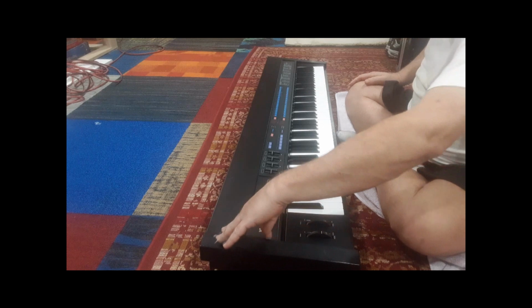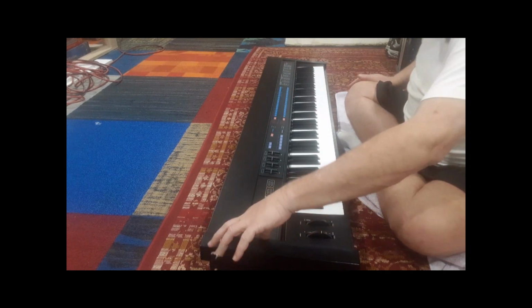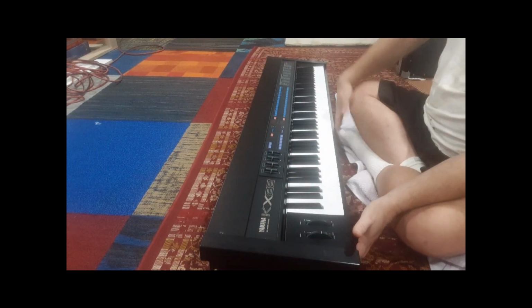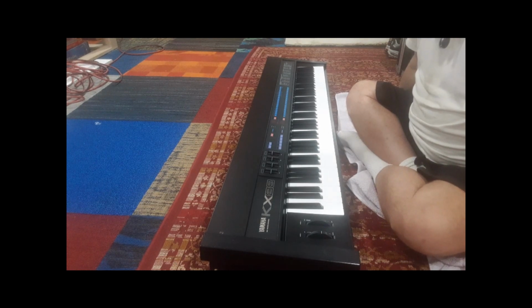And you put the 4 back screws in. Well, actually, you want to put the 4 back screws in, and then you want to flip it up, because you don't want this to flip down while you flip it up. So put the 4 screws in, flip it up, and put all the other screws back in on the bottom. I'm not going to show you that because I think you got that. And then when you're done, you're going to plug it in, and you're going to run the self-test. I'll show you how to perform a self-test on it in another video.